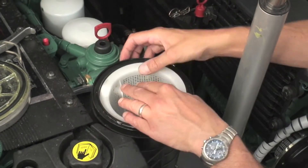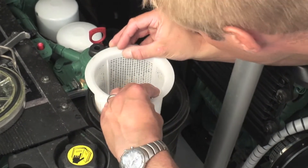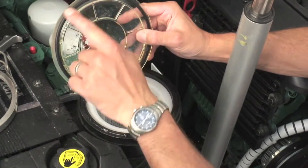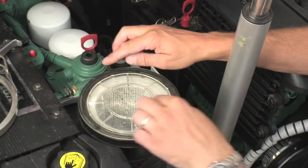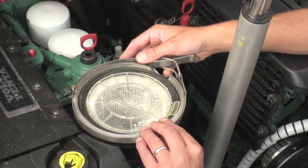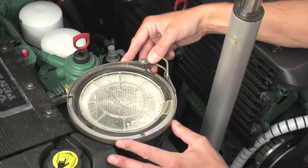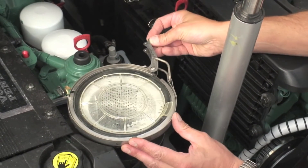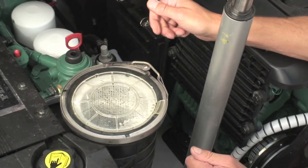If it was grubby we'd have to do a bit of a clean out. It's a little bit fiddly to get it back in — drop that back inside, inspect the rubber ring, make sure it's not damaged, seat that gently, run a finger around the edge to make sure it's not protruding at all. Then on with the clip — again a little bit fiddly — just line it up all the way round, twist it slightly so it doesn't catch on the fuel filter, close, nice and secure.